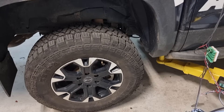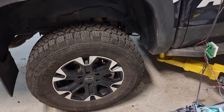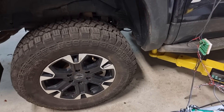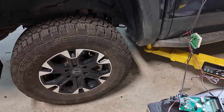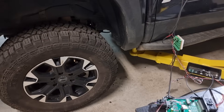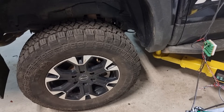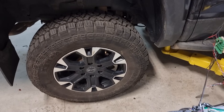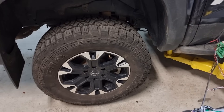So that's the first step. The next step is to fix it up so that it goes back on the road so we can go and do some off-road testing. I can actually monitor the torque command going to the front and rear drive units. We're going to fix it up, keep my board on, take it off-road, monitor the torque command going to the drive unit, and see what it's actually doing — whether the problem is the car not sending the right commands to the motor or the motor not having enough torque.